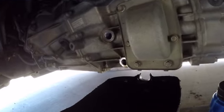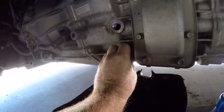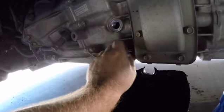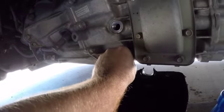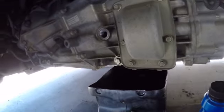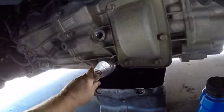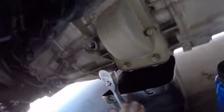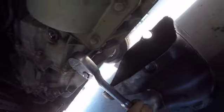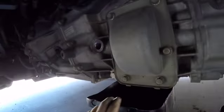Removing the filler plug first. Now we're gonna replace the drain plug. It's important not to do this up too tight - it does have a washer so don't go crazy. I'm using a pretty big ratchet so you don't get much of a feel for it, so you can check what it's meant to be. From experience, that's more than enough.